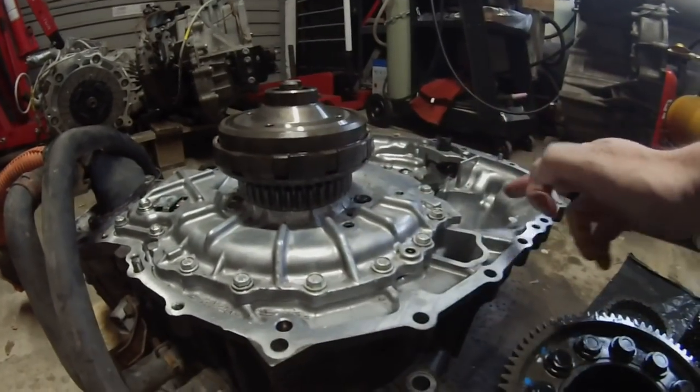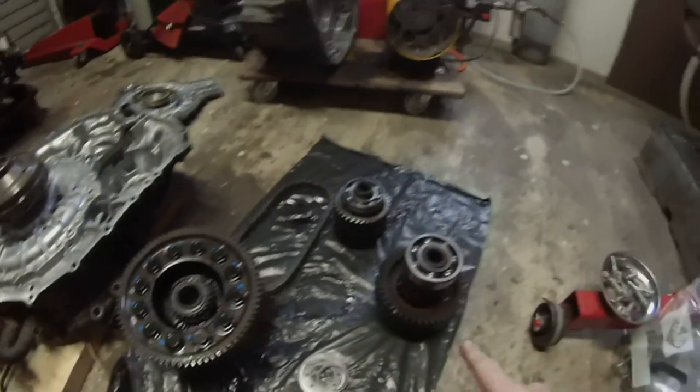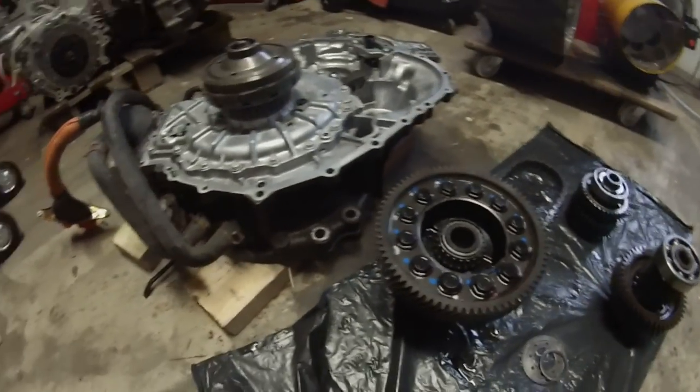And when this gear is placed back on top — MG2 rotor normally sits in on top of this — so now MG1 and MG2 are basically fixed together, and will drive the differential by means of the chain sprocket here and our chain drive and various gear wheels. We are going to use this to make an electric vehicle cheaply, using MG1 and MG2 in parallel to drive the wheels of the car. Hence the modification.